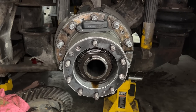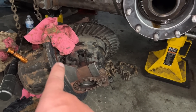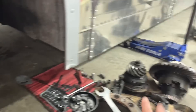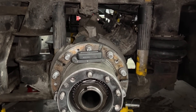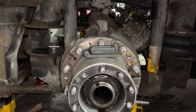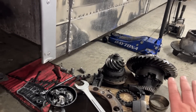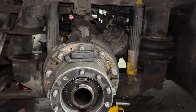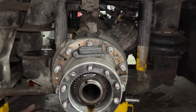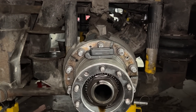That just saves so much time, effort, and energy — and that includes the rear end. So we're going to send this used one back; Brandon's going to come pick it up when he visits Nashville and we'll crate it back up for him. The old one's going to be parted out, and for $1,500 a whole completed assembly is coming in and out. We're just too concerned — the housing has been welded, the pinion was failing because of it. If we put it back together, it's going to fail again. This bus just got upgraded from an 8V71 to an 8V92TA, and we're increasing horsepower. We can't put an already compromised rear end back in.